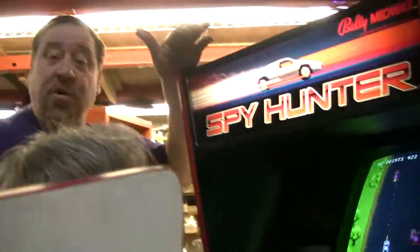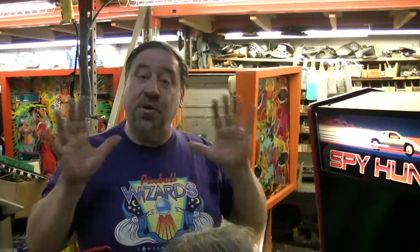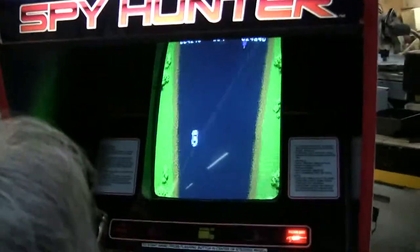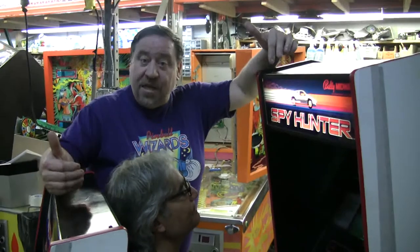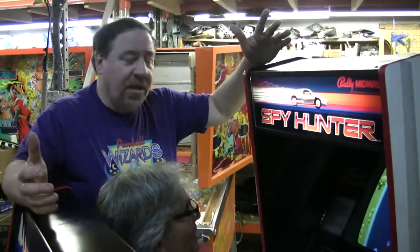What makes this game nice is four speakers. This sit-down cockpit used the same Spy Hunter logic board, but the sound board — the top board — has panning on it. You can always tell because the silk screening on the board says 'W slash panning.' Only two or three other games used a panning board. Tapper used it, even though that was two-speaker stereo. And a football Laserdisc game used it too. The four speakers spread the stereo around so your back head gets the sound of the engine running, and the front speakers have the sound of the missiles and the Peter Gunn music — really great separation.